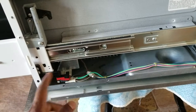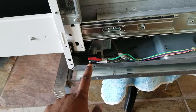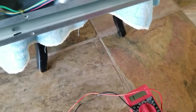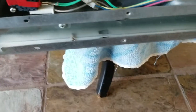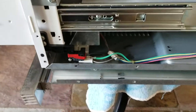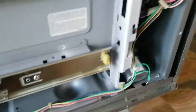You have to check when you open and close the door if the sensors change their state. How you can test that is using the multimeter — just check the resistance on it. Check the resistance between these two ports, one and there's one at the bottom. If the continuity changes when you close or open the door, that means it's working good.